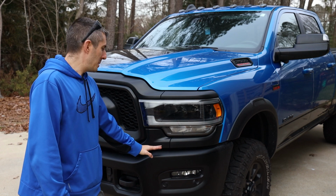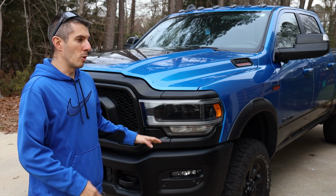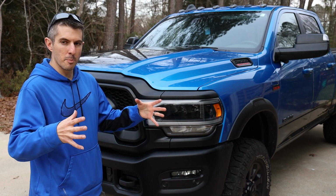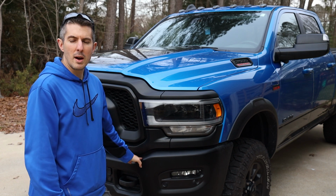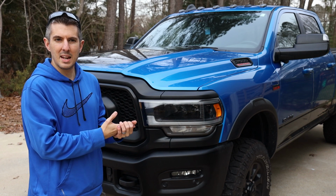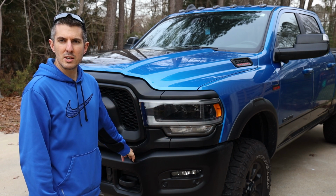It is important you do this step. I know a couple guys that have gone off-roading. One was stuck himself and one other was helping somebody. They had just installed new winches, and a lot of winches come pre-filled with the winch line. They tried to go out and retrieve somebody and the winch line was all tied up and knotted. One was unable to get it undone. It was just too gnarled up. One guy was able to pull it all out and get it out. So it is important to pre-tension your winch line.